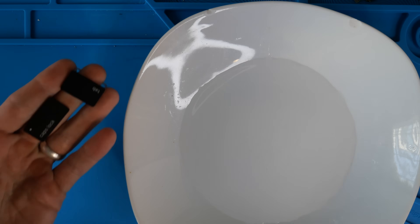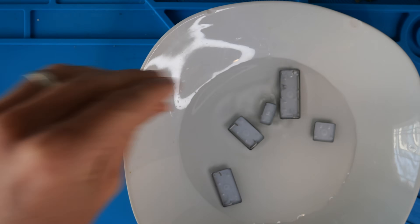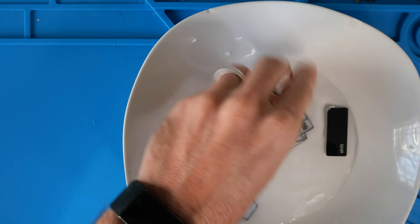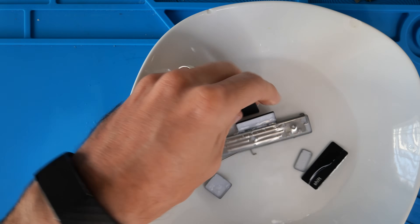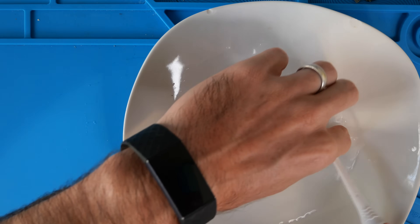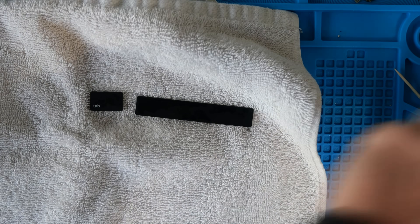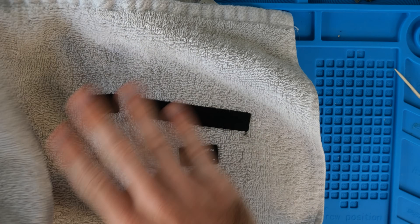Once the gunked-up keys are removed from the keyboard, put them in a plate or bowl of water. This cleans off all the junk — the coffee, sugary soda, whatever you spilled that's causing sticky or crunchy keys. Water dissolves all that sugar and nasty stuff. You can expedite it by brushing with a toothbrush to clean off all of those key caps. Once they've soaked and are clean, take a small hand towel, get the keys out, and dry them off. That takes care of the key caps and the little support wires.